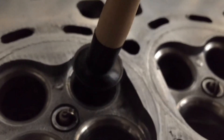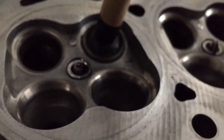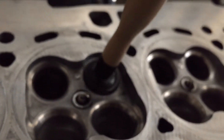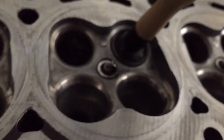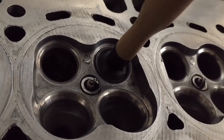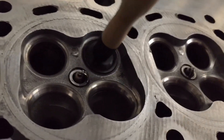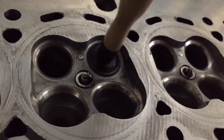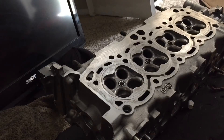You can also hear when a valve is good — it stops like that, see how it doesn't make any noise. When it's not good, it'll make a grinding noise, like you're grinding some rocks. That's how it starts, and you just keep doing this until it's smooth. I'm going to finish the rest of these — the exhaust ones — at least on video.